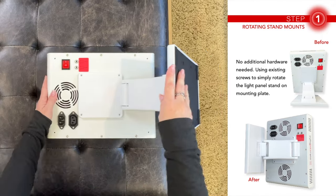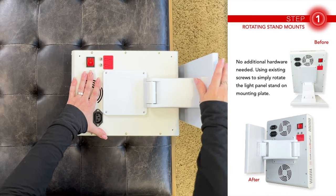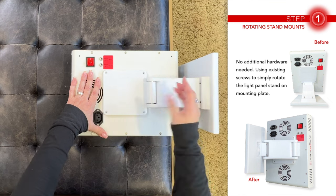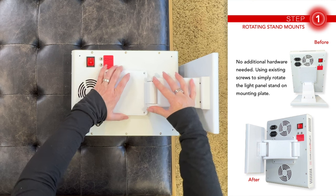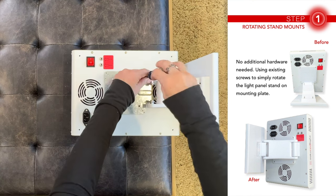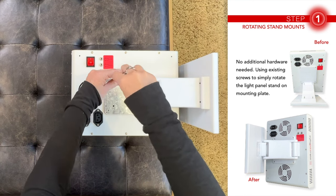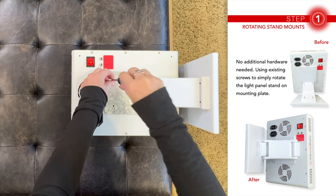With the panel to the edge of your table, push the base down to its lowest position. If you're doing this on a hard surface, put a towel down first to protect it. Now with the stand down, you'll be able to lift the cover straight up. This piece is just plastic, so you don't want to be prying it up from one corner. Now remove all four screws from the metal plate — these will be easy to tell apart later because they're heavier than the other ones.